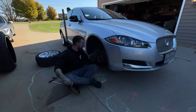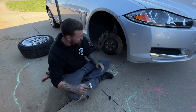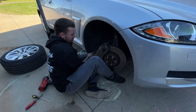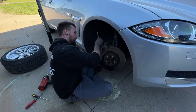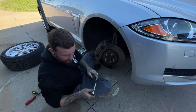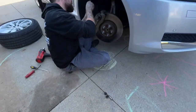Get down here — there's two caps on the back. You'll find these little caps in here; you want to pull them out. They look like such. Get those two caps out and you'll be able to access these bolts right here, and we're going to pull them out completely. Once you start turning on them, they will completely come out. You want to take them all the way out just to make sure they're good. You got to have them out to get the caliper off. That's what they look like right there — that's the shank, and that's what holds the caliper on. We're going to remove both of those.